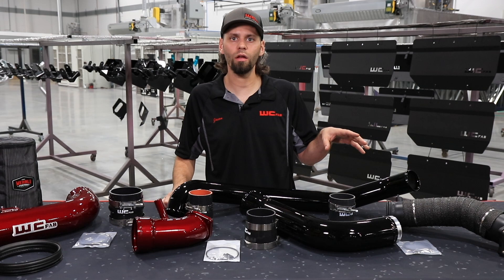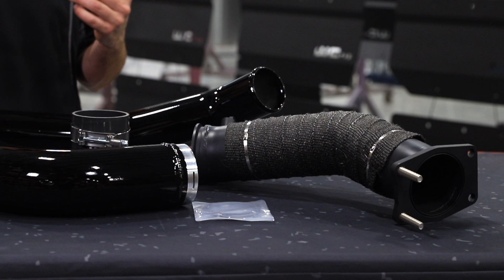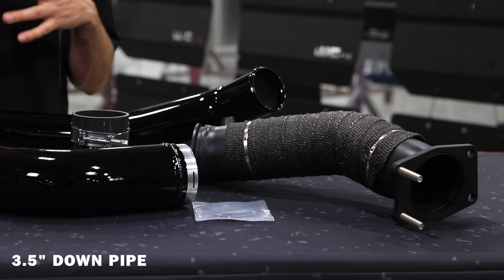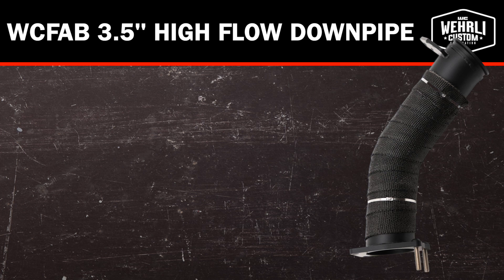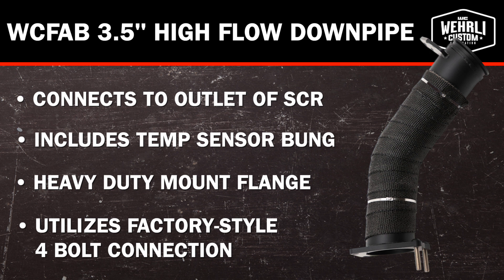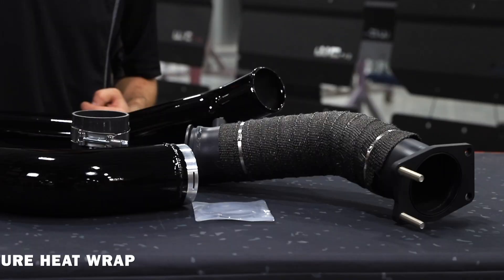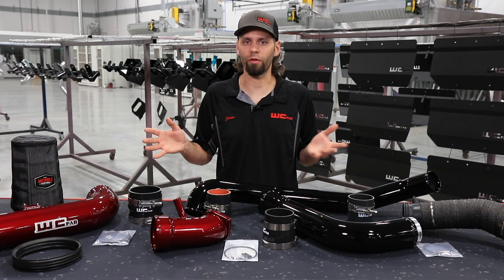Rounding out the Stage 3 intake bundle kit is the exhaust side turbo outlet on the L5P. Just on the back side of the turbo you have the SCR and then the OEM downpipe. The OEM downpipe, like most Duramax previous model years, is crushed in several different directions, so we've designed a three and a half inch mandrel bent pipe — larger than OEM and without the massive crush points restricting flow. It connects to the outlet of the SCR behind the turbo and includes the bung for the temperature sensor, a heavy duty mount flange, and connects to the exhaust system using the same factory style four bolt flange connection. The downpipe comes with a high temp ceramic coat finish for 2000 degree heat resistance as well as a high temperature heat wrap covering.